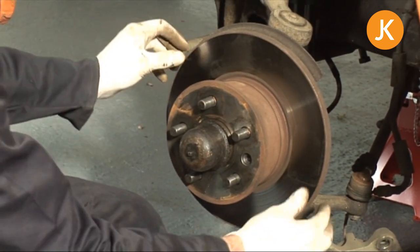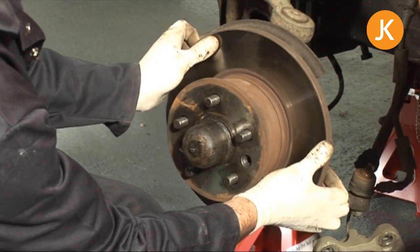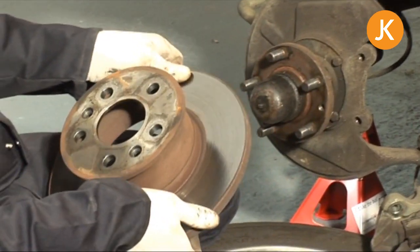It's that little wiggle manoeuvre we need again. There is a chance that it's rusted in place and you might need to give it a tap with a copper hide mallet, but just move it all around and as long as nobody has damaged your dust cap previously, it should slide off there nicely as well. It's as simple as that.